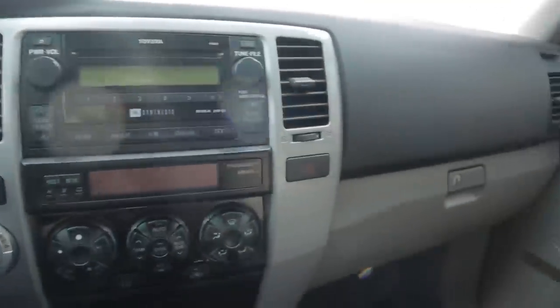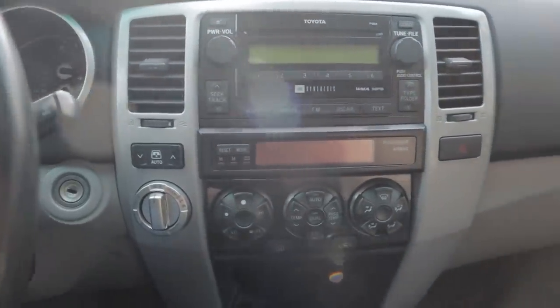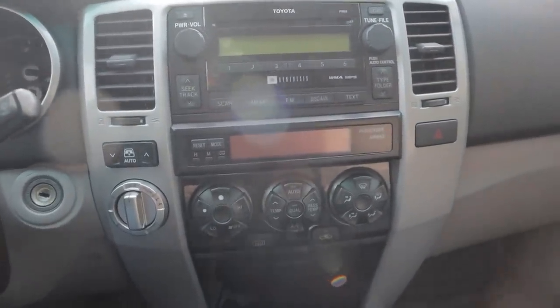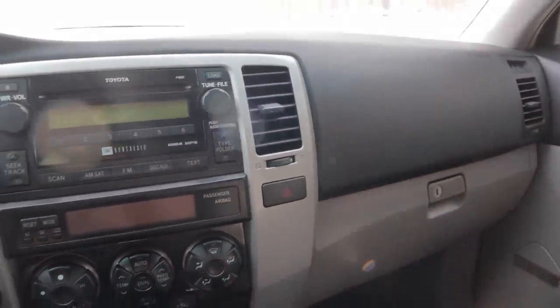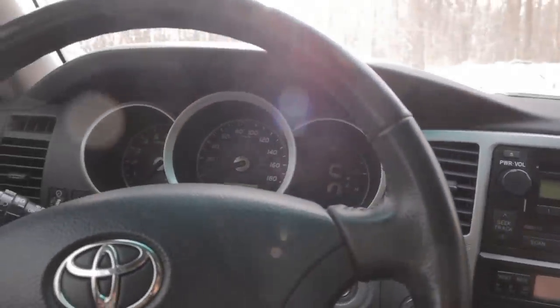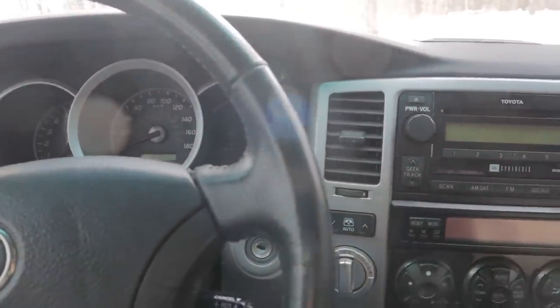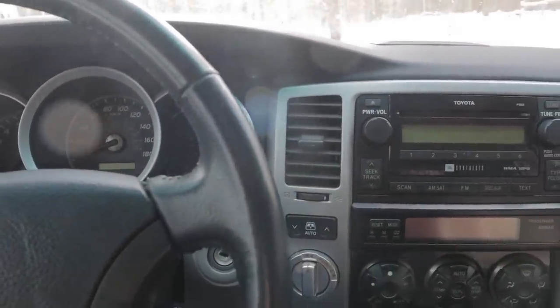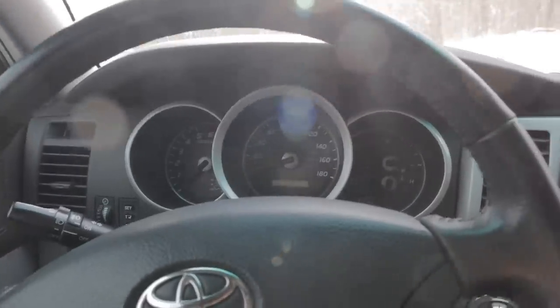And I want to keep everything functional and freed up because, I mean, even a parking brake, if those cables seize up or whatever, then the one time that you do go to use it, if you're loading a car onto a trailer or something like that, boom, you got problems. So it's so easy to just use this stuff once in a while and then you never have a failure. I'm not saying you have to go and rock crawl on the Rubicon trail or anything with four-wheel drive. All you got to do is just cycle it. Use it once a month, in and out, you'll never have a problem.